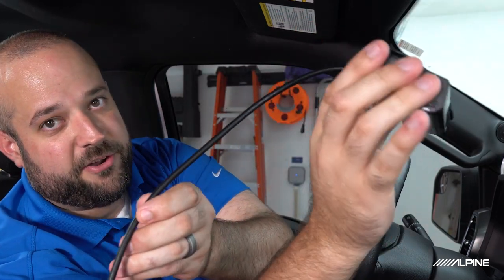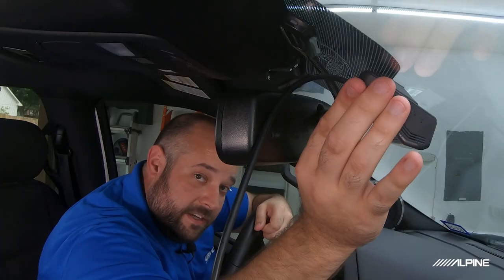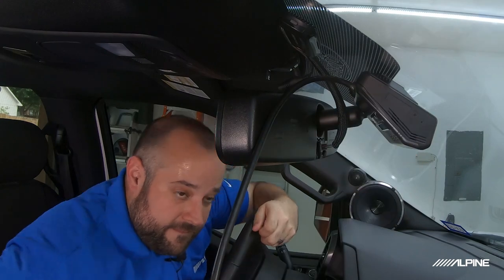Area's cleaned up. Let's go ahead and peel the backing off — use wire cutters or fingernails to get started. Before we stick this, we also want to peel the protective film off in front of the camera. If you fire this up and notice your picture looks a little blue, it's probably because you have the film on there. There's also film over the buttons. When you mount this, make sure it's as square as possible — if it's rotated it will mess up the picture and make it a little crooked, so have it as level with the horizon as possible. Once you have it there, give it some good firm presses. Keep in mind you'll probably rotate your camera to get a better view once it's all powered up.